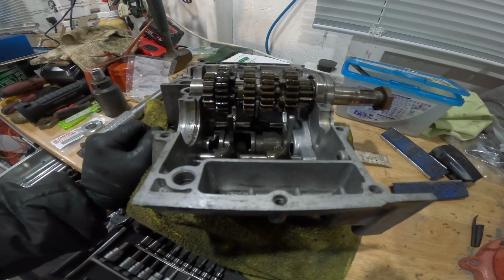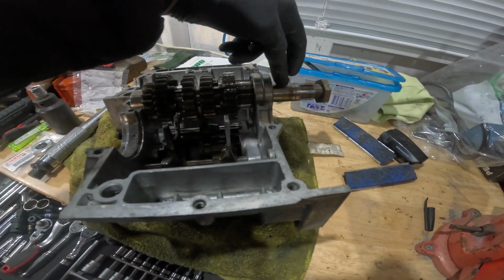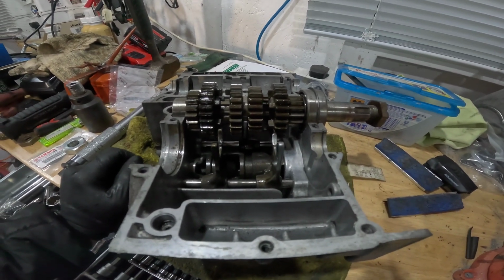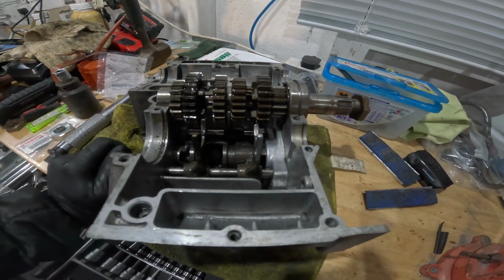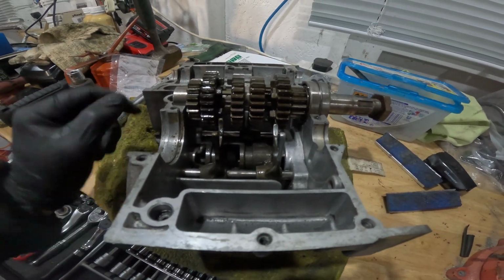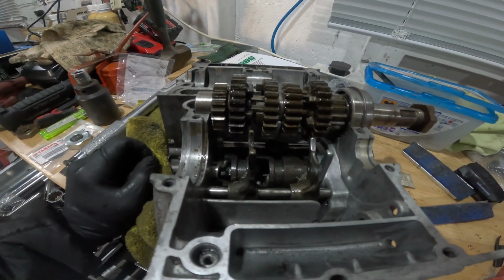I haven't even got to drop in the chassis, because I could lock them up if I put the primary drive gear and the clutch basket on, which are nice and easy. I can use the old 2p piece, bit of copper pipe or whatever you've got handy. I've probably got a bent 2p piece kicking around somewhere from the old LC days. Use them to lock the gears together, because they're softer than the steel, and then we'll give it a go at torquing it up.